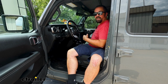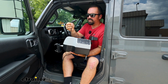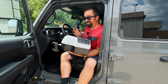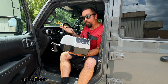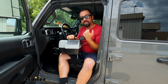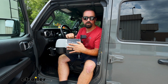In more cases than not, we're installing these for a portable braking system because these run off of 12-volt power that have a cigarette style outlet that plugs in. Now, the issue is a lot of your factory outlets really aren't this style anymore. Most of them have gone to a USB or that doesn't have 12-volt power when the car is off. And then many times in flat tow mode, you will have the key off, so that doesn't have power. And adding the Demco 12-volt kit will always have the power for the braking system to work properly.